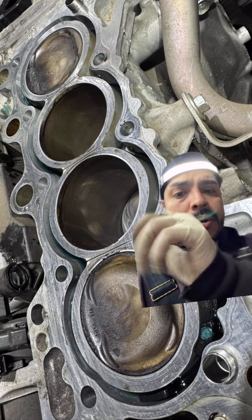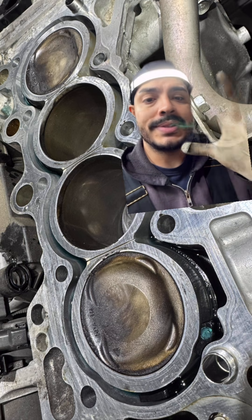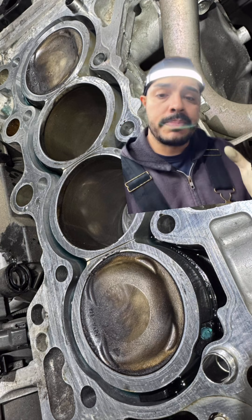This is the layout of the cylinder. There are these little slits. This is cylinder number 1, 2, 3, and 4 at the very top. The area of heat where it's most concentrated is cylinders 2 and 3, because the turbo sits right here — it's mounted to the head — so there's a lot of heat concentrated in this area, which is a big problem.